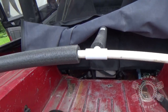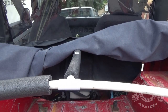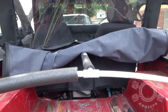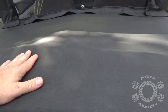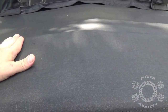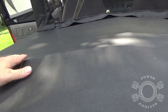Got those in place. I need to get one more length of this. Let me get this thing stretched back on, and there you go — all stretched back on. You can see right here, this is the side that's got the foam, this side doesn't, because it's picking it up off of it a little bit, and it actually smooths this radius out quite a bit. Put that foam roll up there — what the foam roll is going to do is help protect the top, because foam obviously would be much more forgiving than the edges of those pipes right there. It's just going to help protect the fabric and make your top last longer.